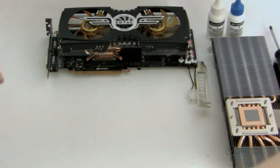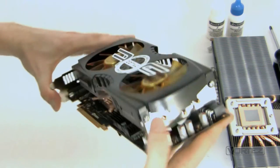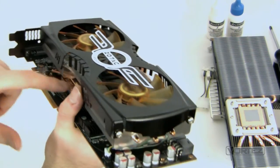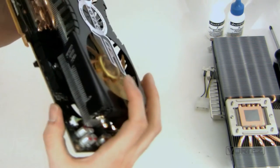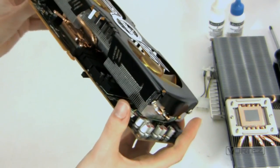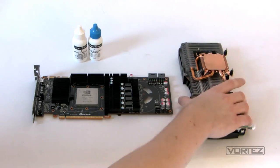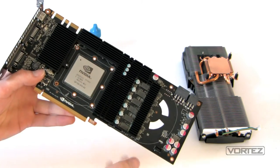We're basically ready to go. What I need to do first is take this Zotac card, take off the Zalman cooler, and then pop on the Arctic cooler. This involves removing the screws on the back to remove the cooler, along with the heat sink that covers the voltage regulators and the RAM chips. I've now removed the Zalman cooler from the Zotac card — really easy, just needed to remove four screws. Once done, the GPU is exposed and there was quite a lot of thermal compound paste stuck to it, set pretty hard.